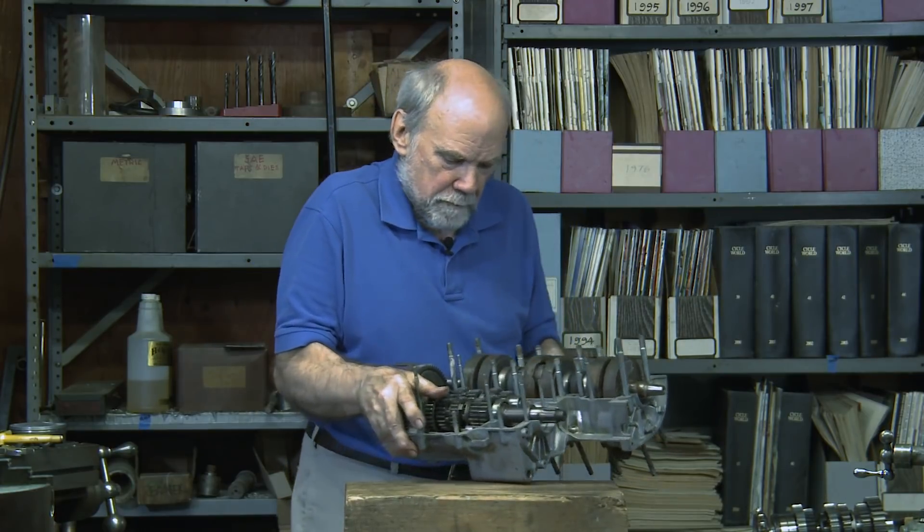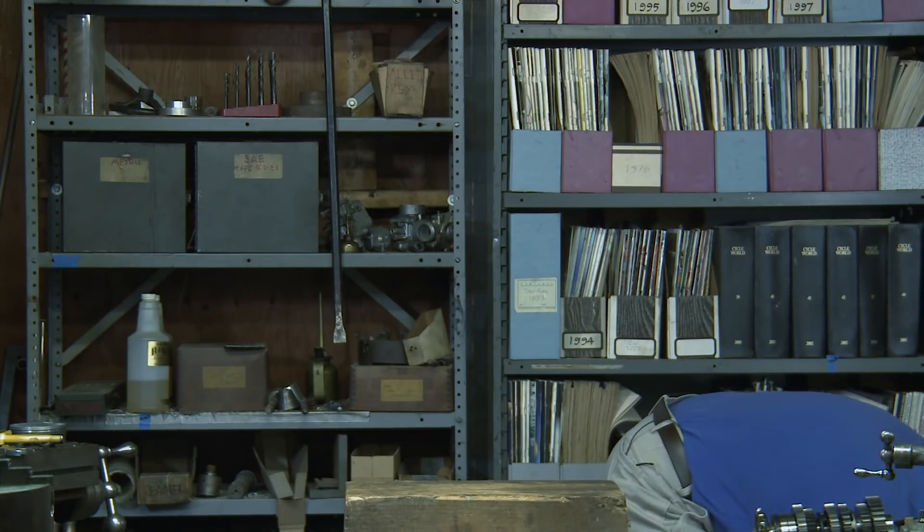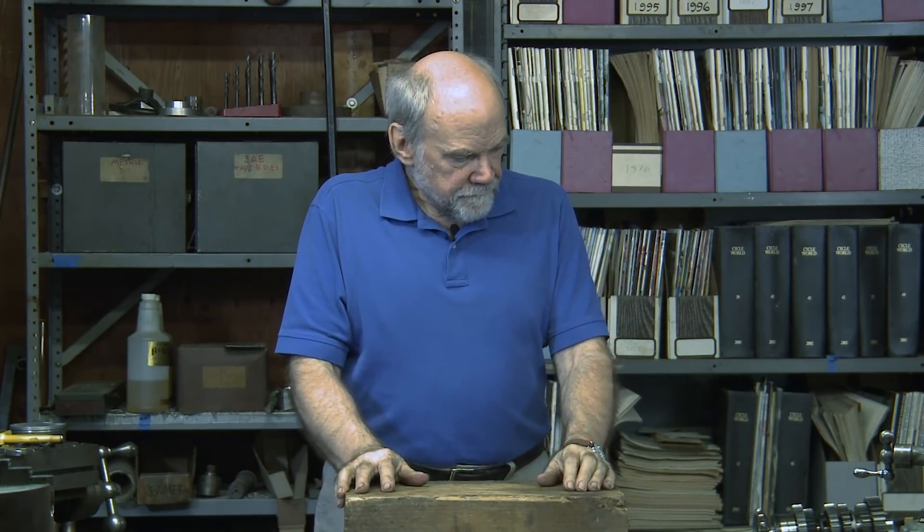Back in 1922, Guzzi in Italy built a motorcycle with a one-cylinder engine with its cylinder horizontal. That made the engine quite long. So they're thinking to themselves, we don't want a really long wheelbase — instead of having the gearbox shafts one ahead of the other, we're going to put them one above the other and save that amount of length, to make the wheelbase shorter. That was the origin of the vertically stacked, one above the other, gearbox. In 1984, Yamaha, on their YZR 500 two-stroke Grand Prix racer, applied vertically stacked construction.